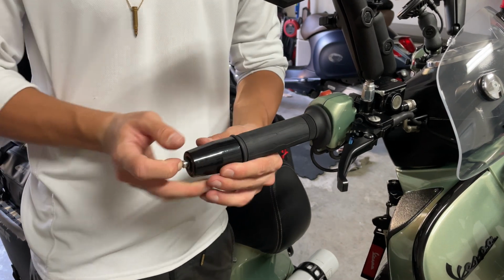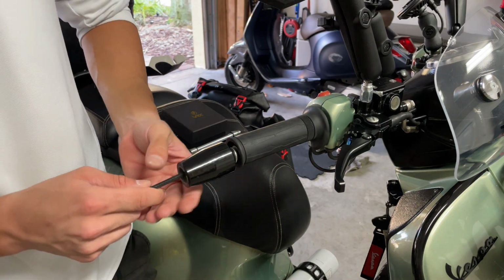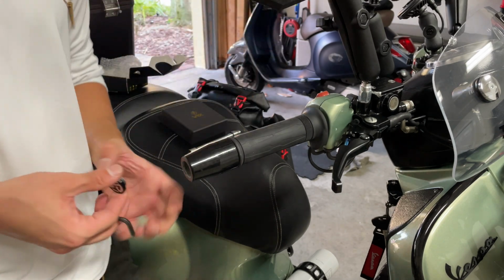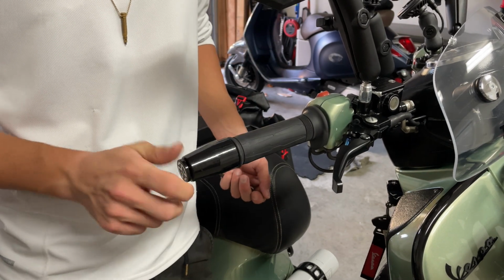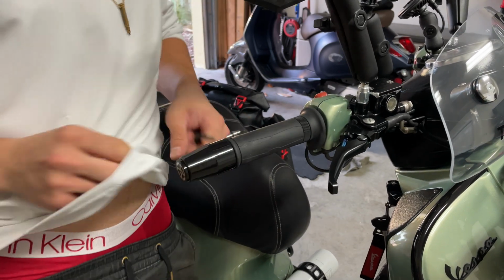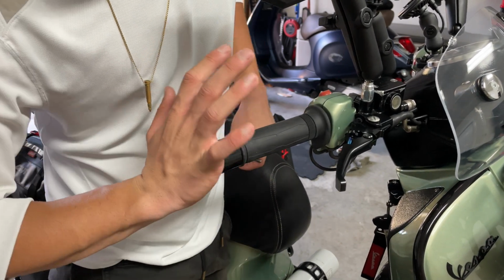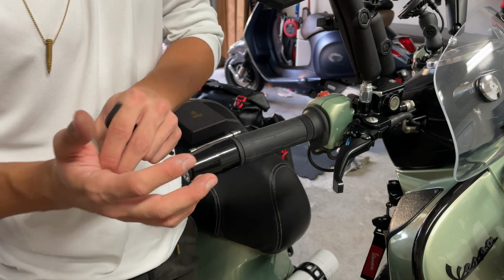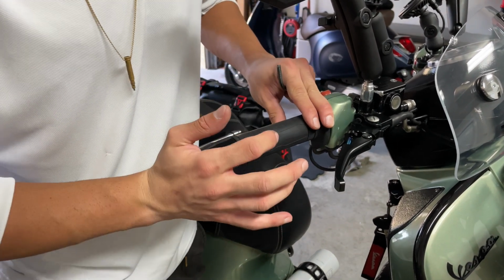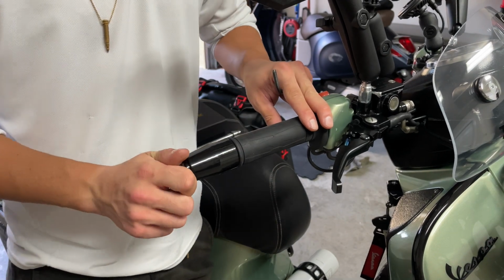As you can see, got enough lag there. Proceed and tie that down really well, and then we can put our cap in. You can always move your bar end weight before you tie it down, so it faces the logo where you want it to be. The way I tie that cap down is just with my palm. I put it there and try to get some grip with my skin so it twists, and it's just snug in there, because you don't want to go too crazy, because then if you want to remove it, it's gonna be a pain in the butt.